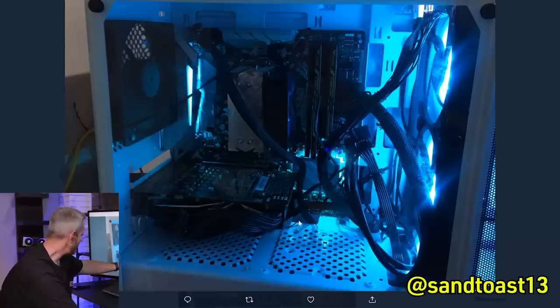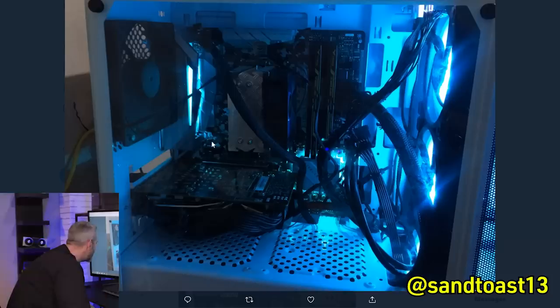I mean, you've got front panel connectors coming up through here. You've got your 8-pin power coming out of right here. Why is that 8-pin coming out of there? There's literally a grommet right above. Right here. Yeah, I just noticed that. And if it'll reach from there to that hole to back, it'll reach from there to behind to up and through. You can rotate the fan 90 degrees to get the cable to come out to where you want it to come out. That's what I always do. I always put the fan cable up here.